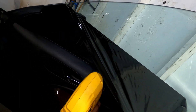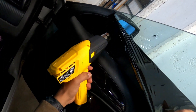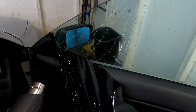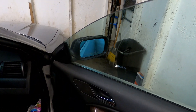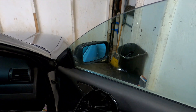Keep in mind I'm doing my best to stay away from the plastic, but at the same time too much heat will burn the film. So my recommendation: once you get to the bottom, just rip it off and you should be good. If you're putting too much heat at the same spot, you start burning the tint — you don't want that. With the steamer it takes it off more cleanly. You will burn the tint with a steamer as well, but not as fast as with the heat gun.